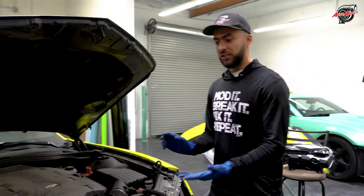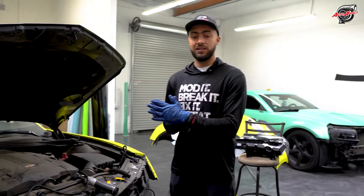But the majority of the time, everything's functioning really good because we build a really good quality T-harness in-house using proper OEM sockets to fit your plugs and the headlights, and really good resistors and relays to make sure the motherboard of the harness is functioning the right way, just like the OEM. And again, I forgot to mention, if you look right here, we will not be adding any switches at all. Everything will be working off this hand switch right here on the bottom to make sure your high beam, low beam, and all that good stuff, and turn signals are fully functional. So you will not be adding or running wires to add an external switch. That's a big, big no-no for us. We want to make sure we're making your life a lot easier. All right, guys, so we already pre-measured this as well.